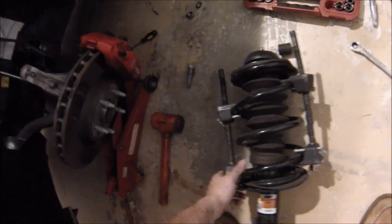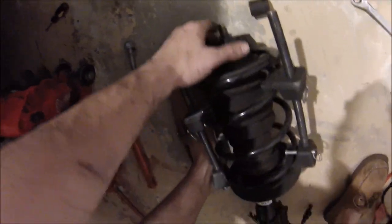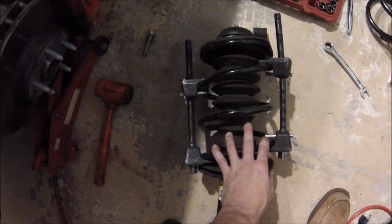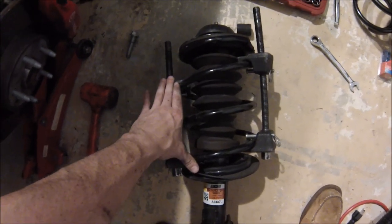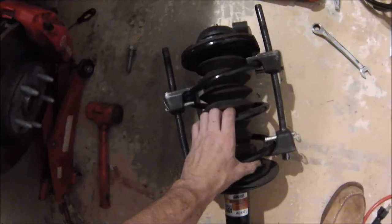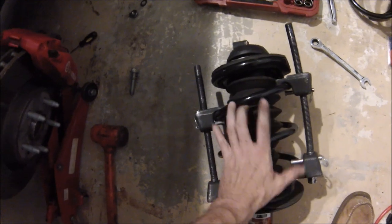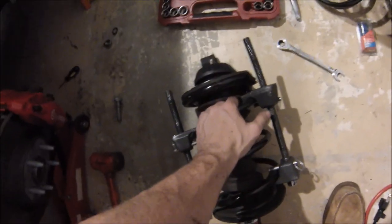So we got the shock out. The next step is to compress the spring and take the hat off. When I say hat, this is the hat — this is the hat bolt. We took that first bolt off, dropped the spring out, then we got our spring compressors on. I think it's like a $60 rental at AutoZone. You basically want to find the highest point and the lowest point you can get the spring compressor on, and you want the same number of coils on each compressor. Here we have one, two, three coils on each side. You want them to try to be even — they don't have to be perfect. You just don't want to collapse the stock spring at an off-kilter position or else you won't be able to get the hat off, or you'll create a dangerous situation.